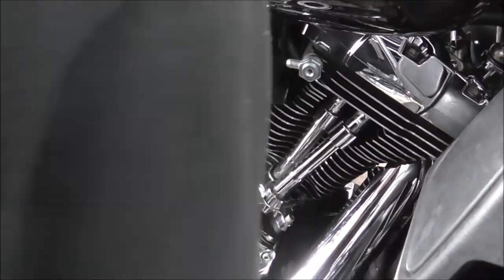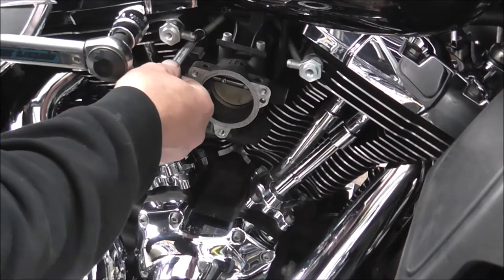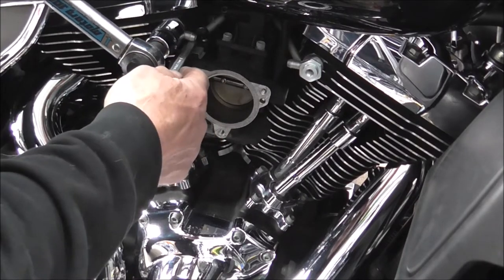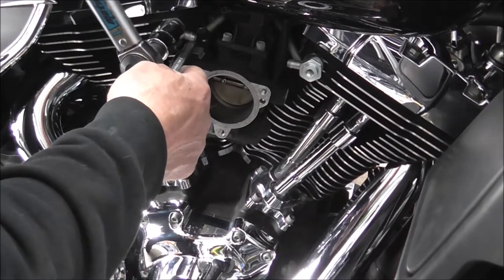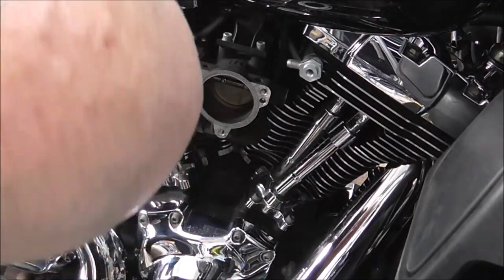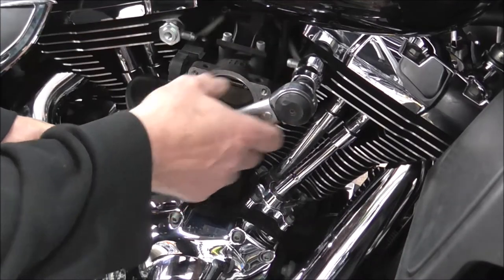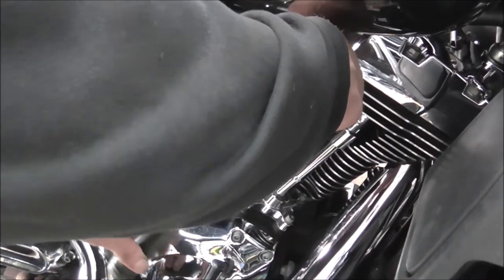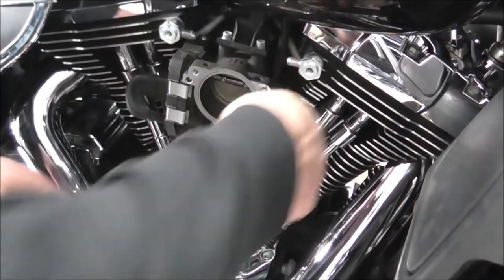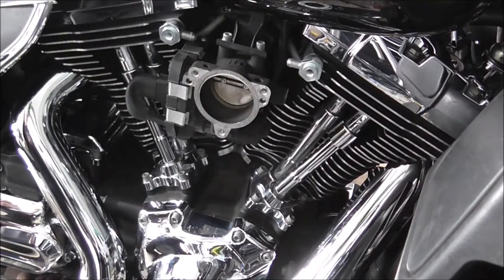Right, I've cut the bit of pipe, which you'll see in a second. But what I'm just going to quickly do now is put my spanner under there and torque these bolts up to 12 foot-pound, and I don't want that to move. Same on this one, where I'll be able to get my finger under there, I think, or above it even. That's just moved. Right, that's them tight to 12 foot-pound, like it said in the book on the instructions. I'll just wind that off.